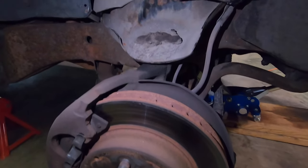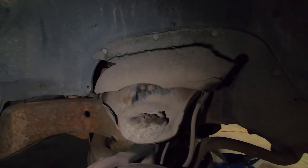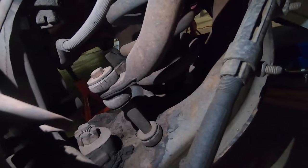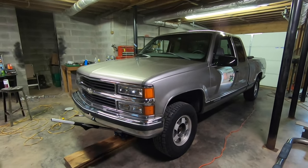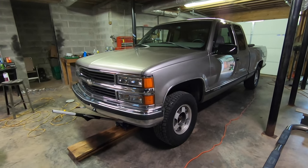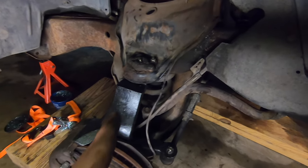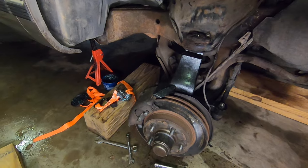We've got quite a lot of buildup under here, and that top piece is torn so we definitely need to replace that. There are some old bushings and grease buildup, but nothing looking too bad. Let me get this side knocked out and then I'll have a good idea of exactly what to show y'all. Just got this side wrapped up and, as you can see, we will definitely have to do some extended brake lines if we go any taller, but it's a fairly straightforward install.